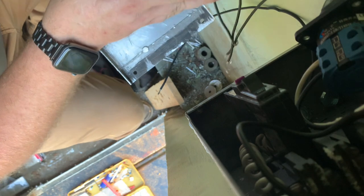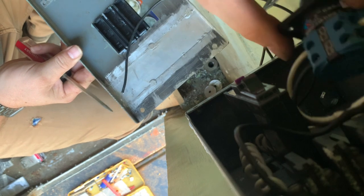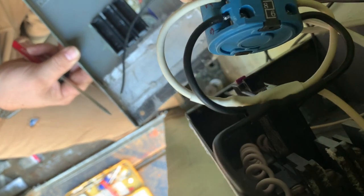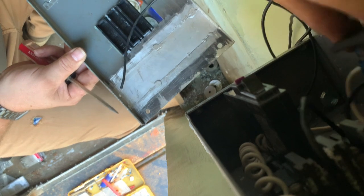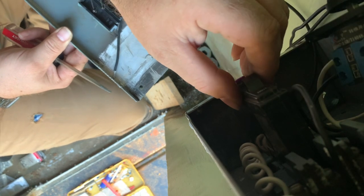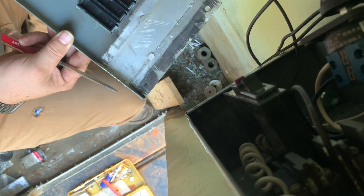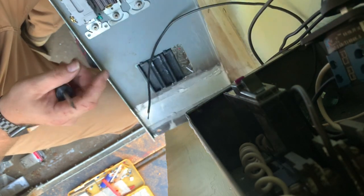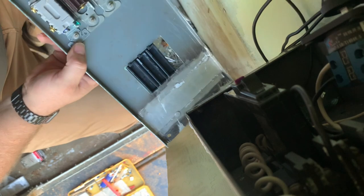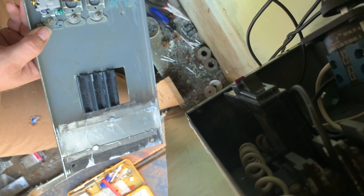Okay. So, my shore power feeds the breaker. So I have two inputs on the shore power switch here. Two inputs, one output. The output goes to the neutral bar and the feed on the breaker load center, respectively. The hot out of the breaker goes up to our three circuit switches. Just like original, they had the hot feed one of the switches and then they were all ganged together. So we'll get this main hot in here.